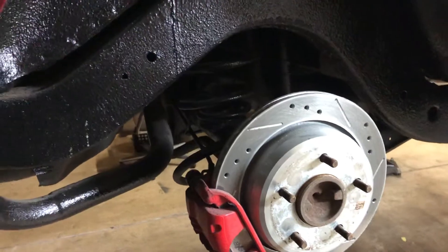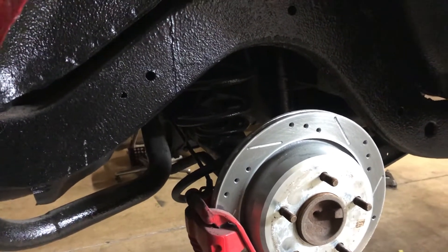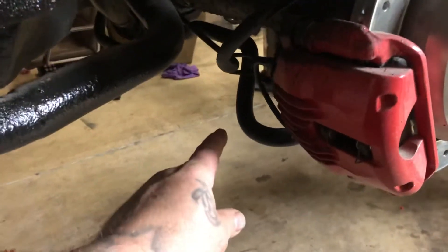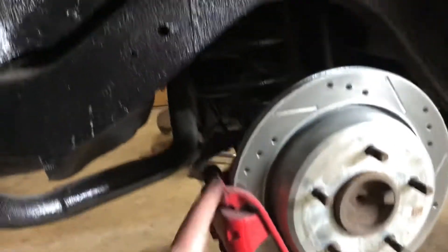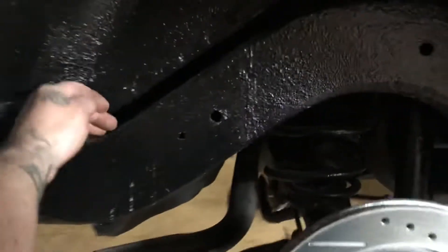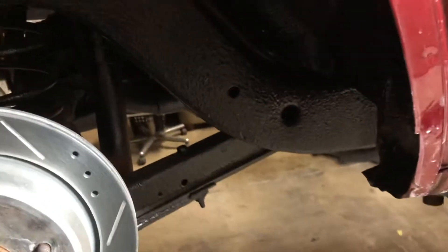13 overall. I'm taking 3 and 3-quarter inches off of each side, putting the adjustable lower buckets on there, getting rid of that stock sway bar — it's getting anti-roll, getting coilovers. Frame notch the full rail, about an inch in, as far up and as far back as I can.